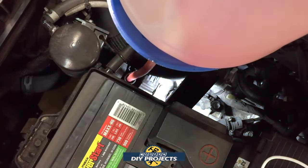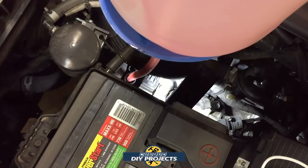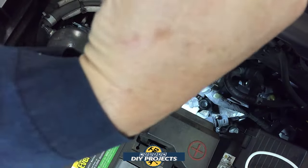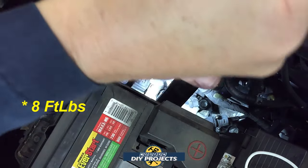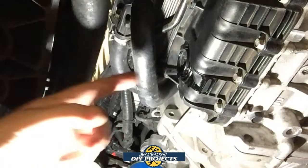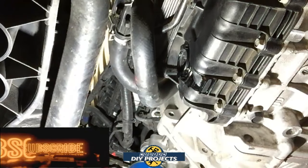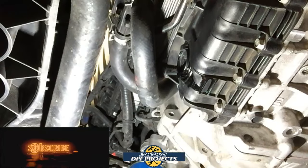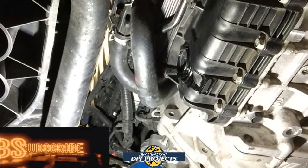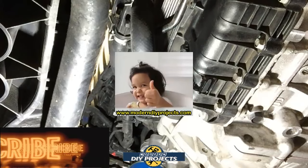That is the same exact amount I took out — I just put it back in. I put the fill plug back in down there and tightened it up — hand tight, about 8 to 10 Newton meters, not really a lot. You can see the level indicator plug right there; I took that off and a little drip came out, indicating it is full to the proper capacity. This is done — we finished the transmission fluid change. Hope you enjoyed the video, hit that thumbs up button, hit that subscribe button, and I'll see you on the next one.